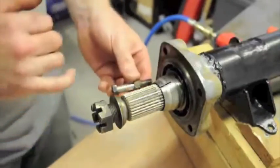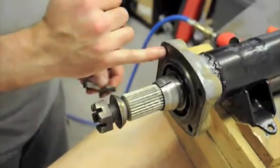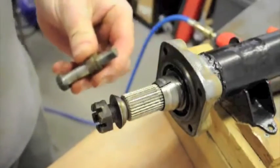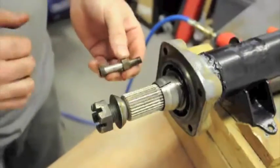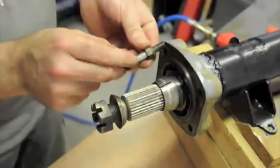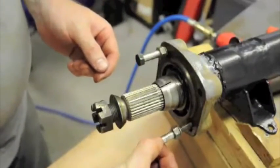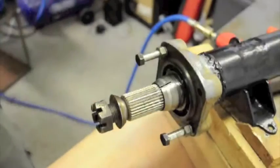these are the bolts that hold the bearing cover onto the end of the axle tube. They also hold the back plate on. They went in like this. I'm going to buy new ones of these because they're pretty grotty and they've been damaged in places at the end, which makes them hard to wind the nuts onto. But for the time being, I'm going to use these as spacers like this. Put one in this hole here, one equal length, one in this hole here. And then I'm going to slide on.